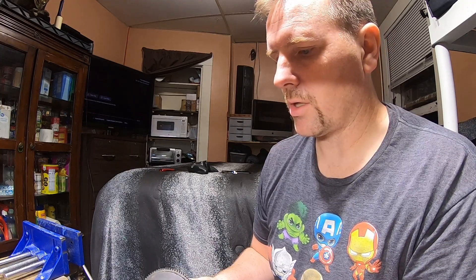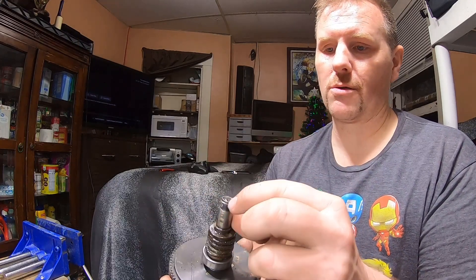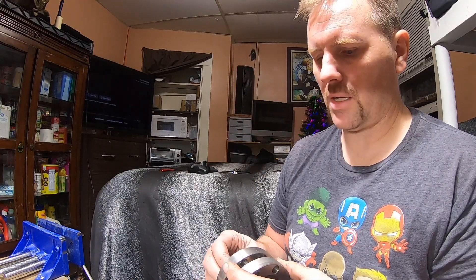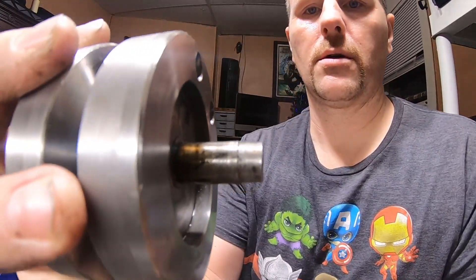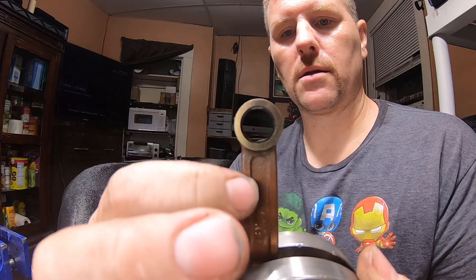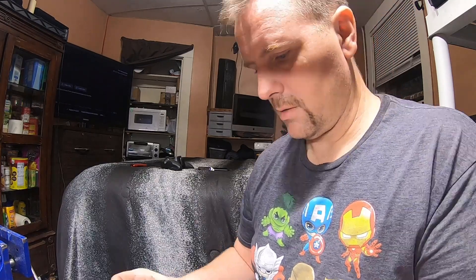Benny had to leave — he's got a hot date. I showed you the case I cracked — we can work with that, not a big deal. I'm going to need a new clutch armature shaft because it was wallowed out to begin with, and there's a piece of plastic stuck in there from my handle. The threads got squished because there wasn't much metal there to begin with. Things we noticed immediately: on the shaft you can see lines running around it — this was spinning inside the bearing at one point.